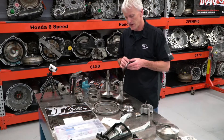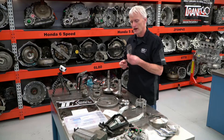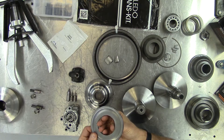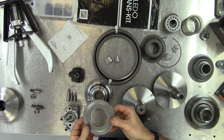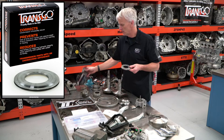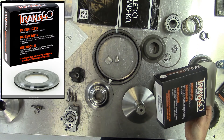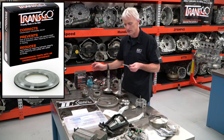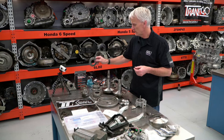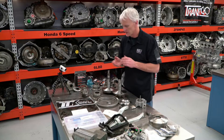If you're working on a JF-015, that's the one that has the auxiliary gearbox. On their primary pulley, they have a little piston that's a press fit on the inner surface. Sometimes that gets loose — this one that came out of a unit does not fit with the press fit in that center section. Trans-Go makes a replacement billet piston for that, and it's something you're going to want to do on every JF-015E — everyone should get one of those billet pistons. That is a good upgrade.